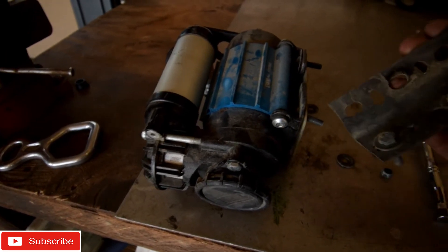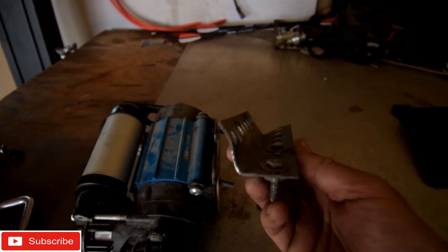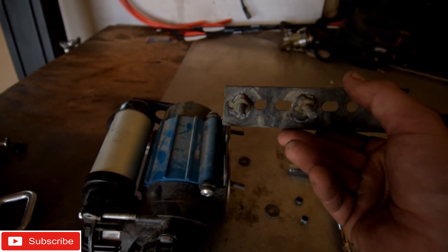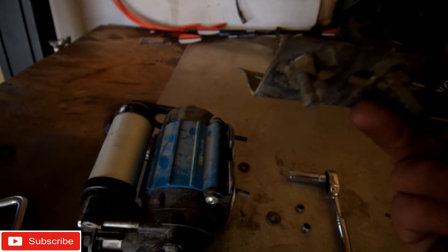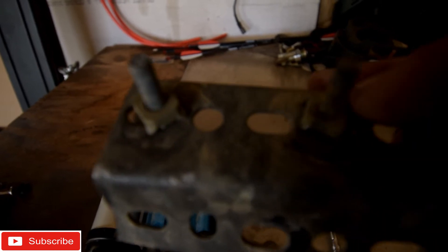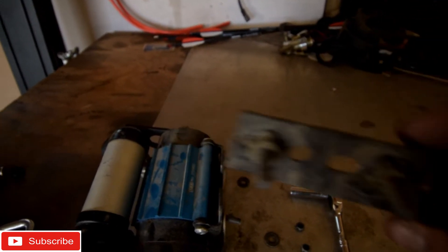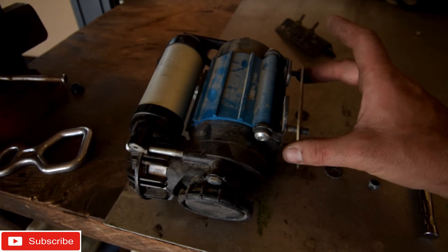This is what I had homemade — just a piece of angle iron — and you can tell it really took a beating on that whoop. It completely bent, not only in the mount itself, but it pulled the bolts right out of the truck. These were factory mounts already in the truck — I didn't add these. Between the angle iron and the nut is sheet metal, so that was a lot of force. We don't need that anymore.